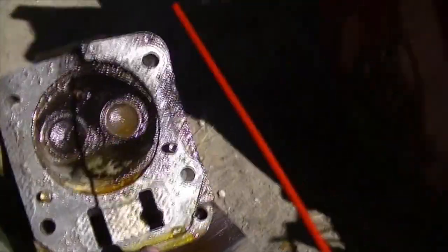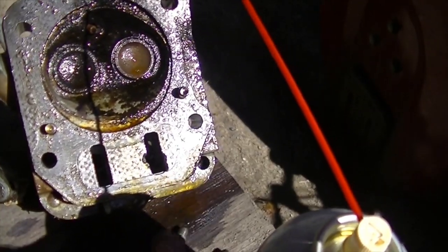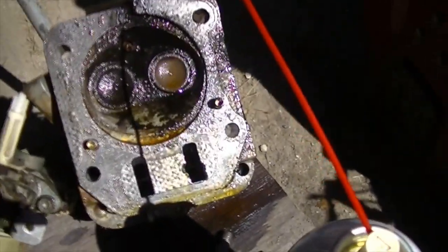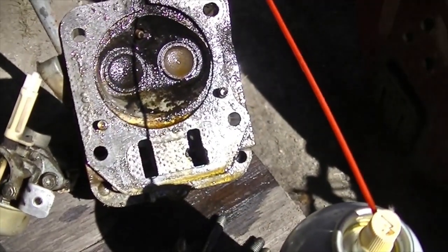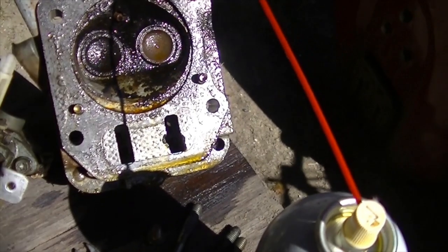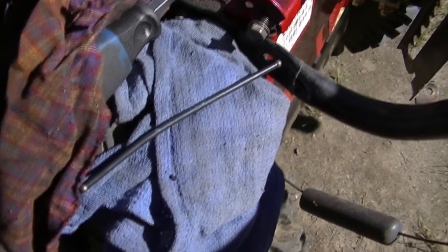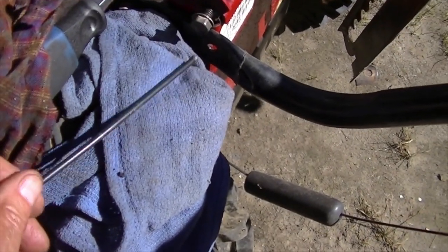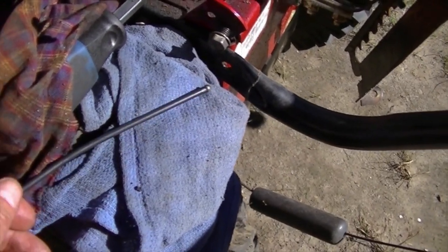I just want to note I saw some wear here, back and forth from the push rod. I think I adjusted the valves when I first got this and they were way off, if I remember right. I think we found out why that gasket was like it is — this baby is bent. Not sure what I'm going to do about that. Let me just bend it back.